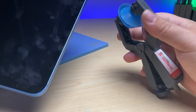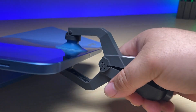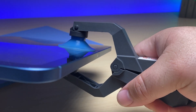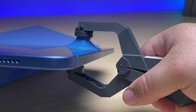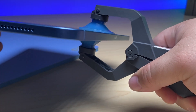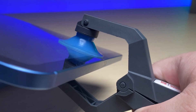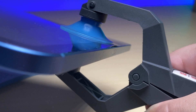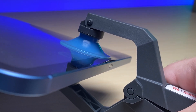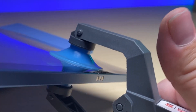After a minute or so, I can put a little bit of pressure down with the suction tool. And when I start to lift, what will happen is you'll notice that the display will bow in the middle. The goal here is to start to see some sort of movement on the edge. And you can see right there, we're starting to get it to want to separate. I'm just going to leave it here with this little amount of pressure — I'm really not squeezing too hard, but we've already got some decent separation there.